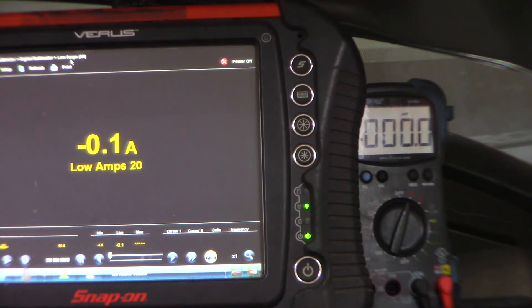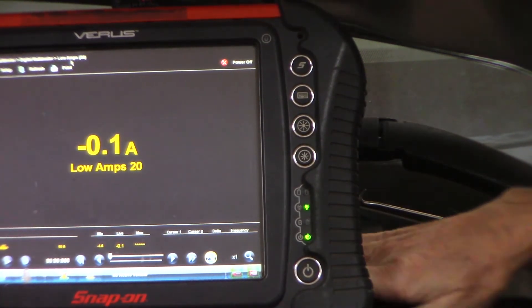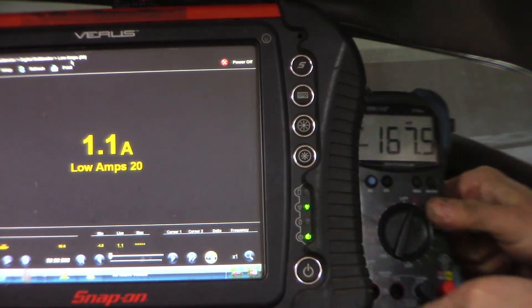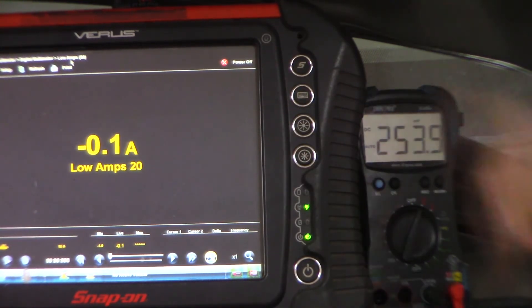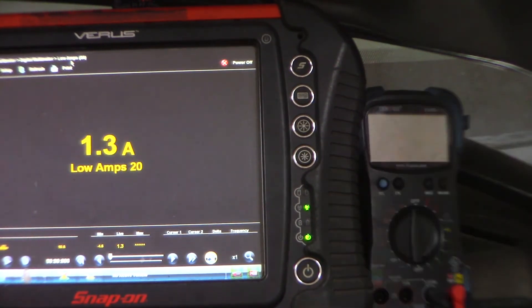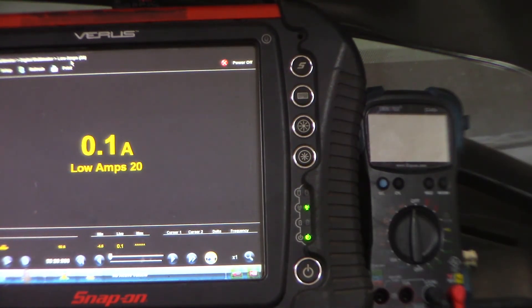So I want to look that up and pull this fuse. M12 — it's a radio. I'm going to disconnect that 30 amp fuse for the radio and see if this cyclical draw goes away. I think it might. I'm going to leave the fuse in until it comes back, then pull it and we should see it drop right back down. There it goes — so if I pull this fuse... there you go. Radio. Very common actually. 200 milliamps, 0.1 amp — back to nothing basically.